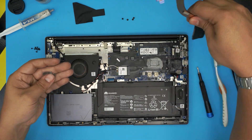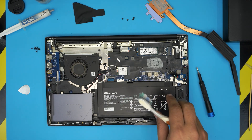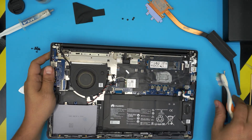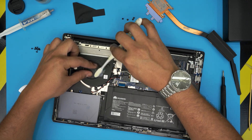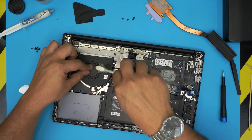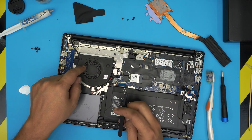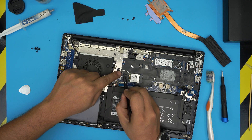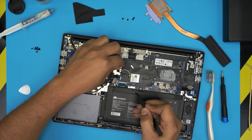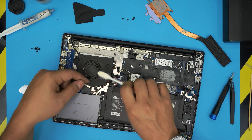Regarding the fan, you want to remove all the dust. You can take it outside and blow compressed air through it, then clean with a toothbrush — gently rotate as you go. The fan connector is right there. Important: if you want to blow compressed air through the fan, you must disconnect the fan cable first, otherwise you'll invert voltage back to the board. To disconnect the fan cable, just pull the jack upward — it's a sliding jack. Once disconnected, you can safely blow air through the fan without voltage going to the motherboard.